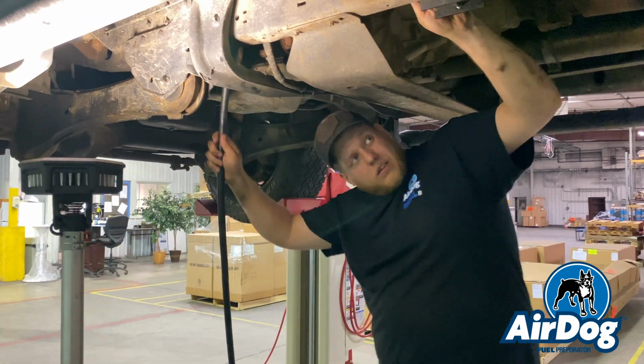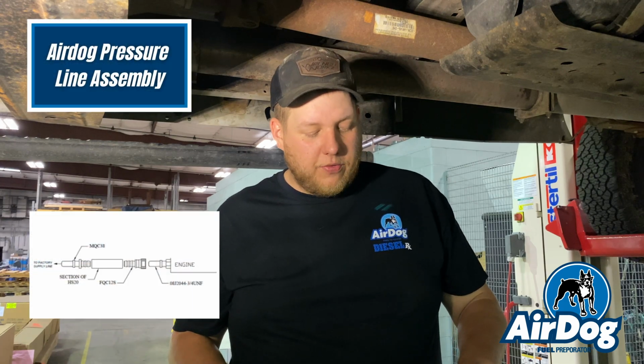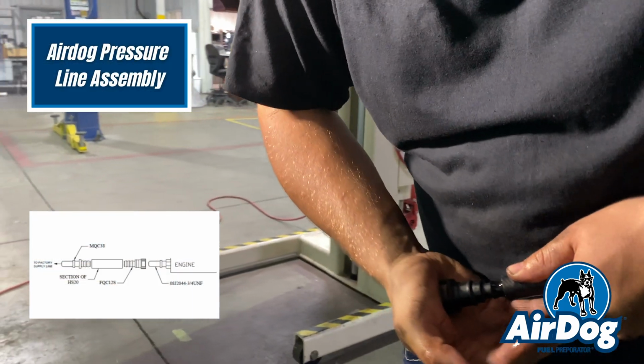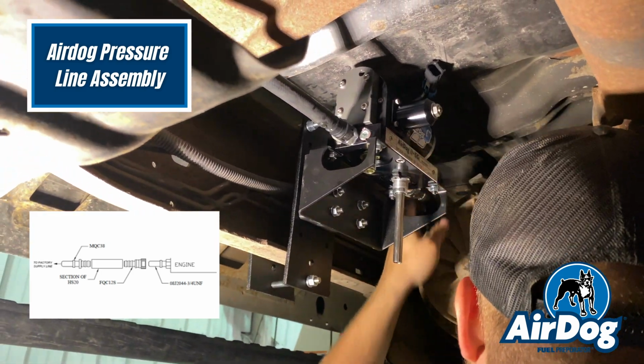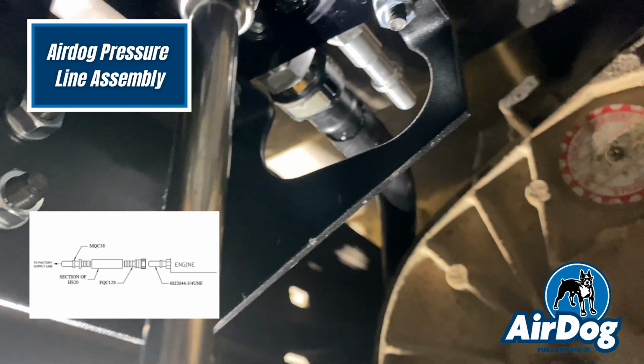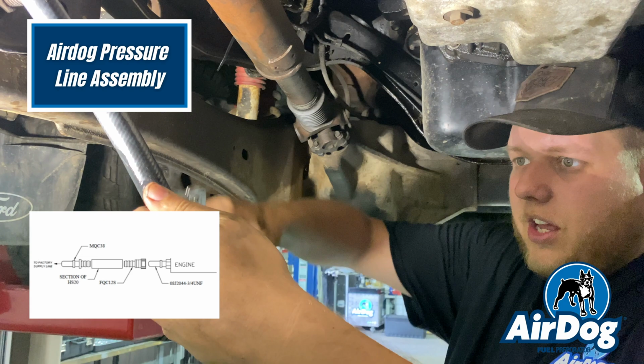So now that we've prepped up at the factory lift pump, we're going to make the Airdog outlet line and then connect back to that factory connection. So first we're going to want to oil up our hose, and we're going to press in a 1/2" Airdog straight quick connect. So now that we've determined the length of the Airdog hose we need to get up to this factory quick connect, we're going to go ahead and cut the Airdog hose.